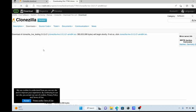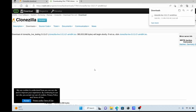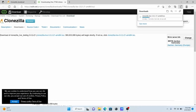While that's downloading, let me explain why to use Clonezilla instead of a proprietary tool. Samsung, for instance, includes a utility that runs on Windows to clone to their Samsung drives — that's great if you have a Samsung drive. But Clonezilla is independent of both the hard drive manufacturer and the operating system, so you can use it even if you're running Linux.